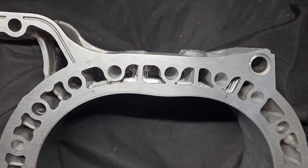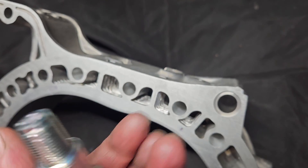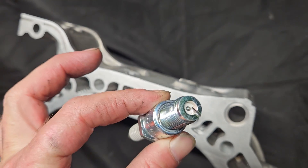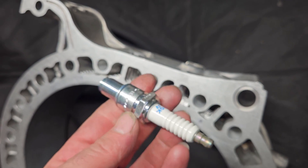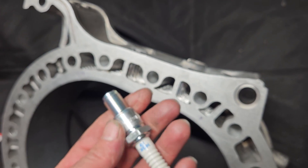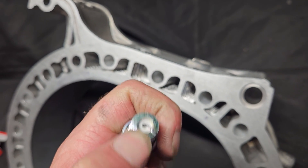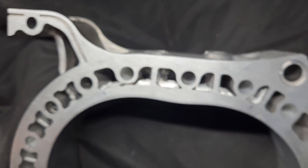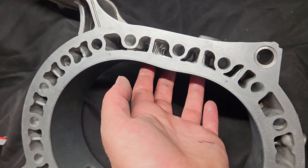If you're familiar with rotary engines, you already know that the spark plugs are kind of unique. These particular ones are the 11-5s, so this would be one of the coolest plugs you can get from NGK Racing. It's going to help protect against detonation, help keep excessive heat buildup down, which protects your ceramic and electrode, and also can help with the stagnation and heat buildup in the rotor housings.